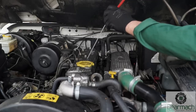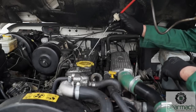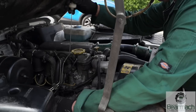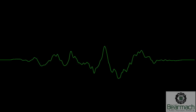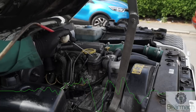Running across the top of the rocker cover, I have found a distinct tapping noise, but I'm just making sure first that the rest of the tappets are okay. What we have is around about number one, number two valve on the first cylinder — it seems to be making a large tapping noise. I'm moving from one to the other, and in the clip you're about to hear you'll hear the difference. I apologise for the bit of wind in the audio, but here it is again with visuals.